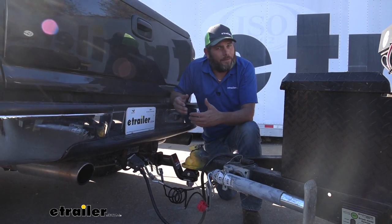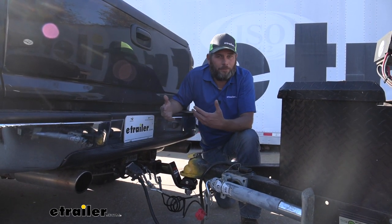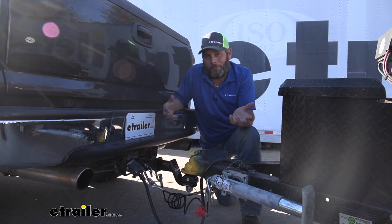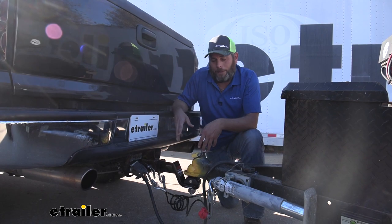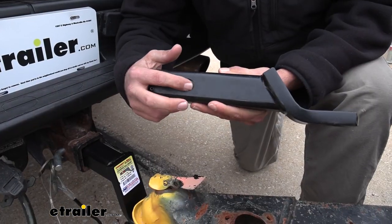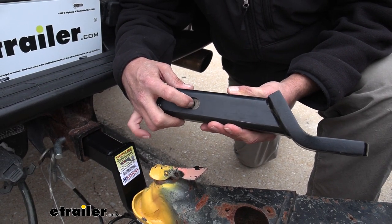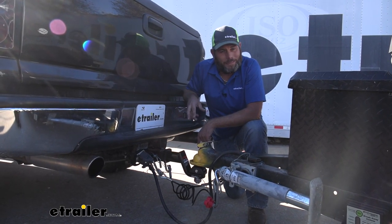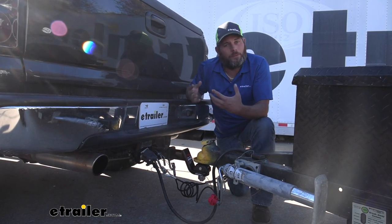Now overall guys, I have noticed a slight difference with this, and I think for longer trips or if you're always hauling a trailer all around the country, this could add some comfort and help reduce some strain on the truck. If you use a utility trailer once every six months to go pick up some mulch or stone, it might not be worth the investment. Now another option that'll do about the same thing is the convertible cushioned ball mount — that takes a ball mount and puts shock absorbers inside of it, so the pin locks a disc or tab and then allows a little bit of forward and back movement. In my experience, I think the convertible works a little bit better. So if it were my money, I would buy the convertible cushioned ball mount, although I think this one does give us some improvements over just a standard ball mount.